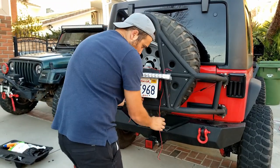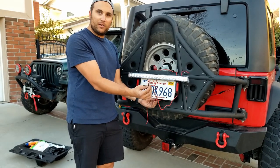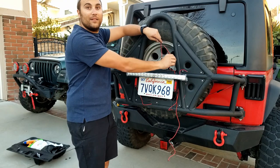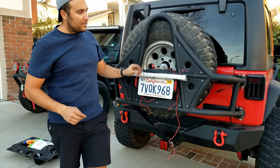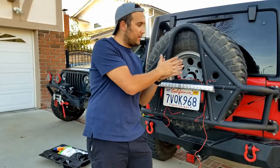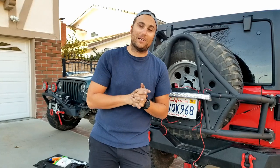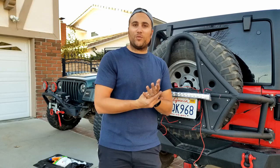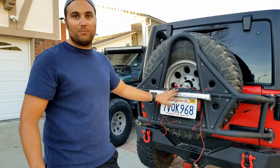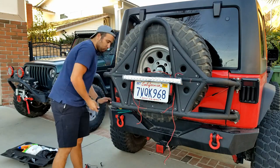It's all bolted on — look at that. Sick. These are the two brake lights; we're going to connect them to what we had initially connected to the strober so our brakes go ahead and flash. This wire is for our license plate light, so we'll connect that to the license plate light wires. Last but not least, we're going to run the light bar wires all the way to the front where the battery is. We decided to disconnect our rock light wires and connect the light bar to those instead, since we're eventually going to change our rock lights anyway. I've never seen another Wrangler with one of these — it's a nice all-in-one system: license plate light, brake light, rear light bar. It just looks super clean.